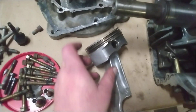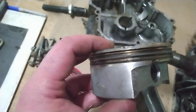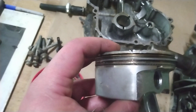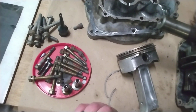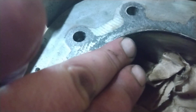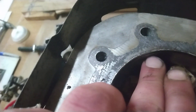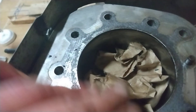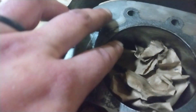Now I get to put some new rings on. Hopefully I can get a small grinding wheel in there and open that up a little — the tolerances on these things are unbelievably close for them to function correctly. I might just go ahead and buy a new piston, but if I can get it close enough for the ring to do its job... As for the sleeve, I'm going to try to get the roughness out — just barely tap it with a real fine sanding wheel. I think that groove can be buffed. Being that it's at the top of the stroke, I won't lose too much compression if I knock just a hair of metal out. I might just deburr that rather than digging to try to get it smooth.